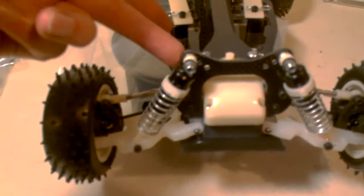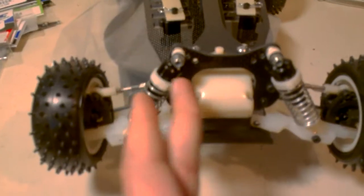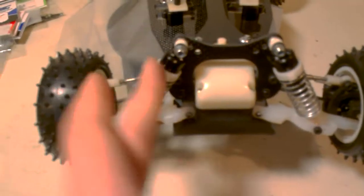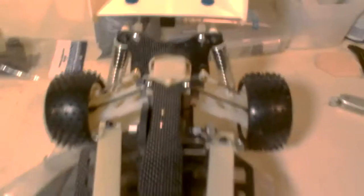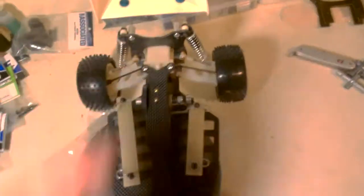The second one are the front and rear shock towers. Right, these are obvious. The front shock towers in the 91 have a concave outer surface here. The 92 towers have sort of a convex outer surface. And in the rear, the 91 top part of this tower is flat. And on the 92, it sort of tapers over a bit. Okay, so that's a very quick way to tell if you have a 92 Works or 91 Works. Check the belts. Check the shock towers.